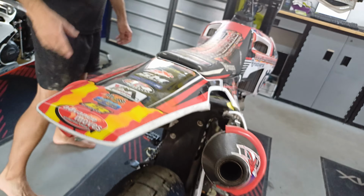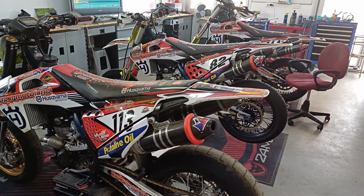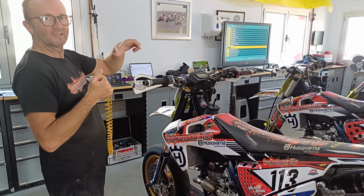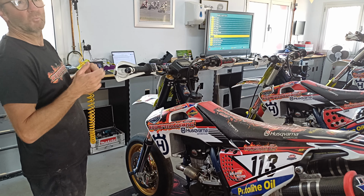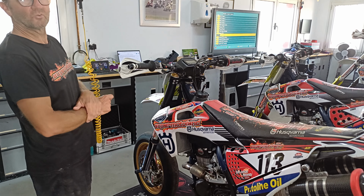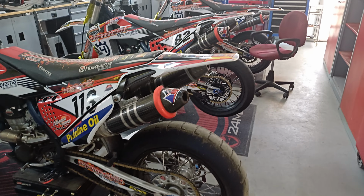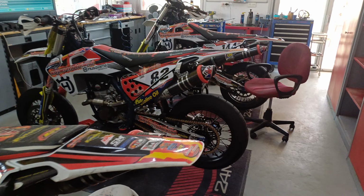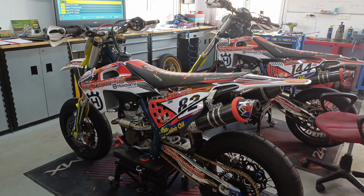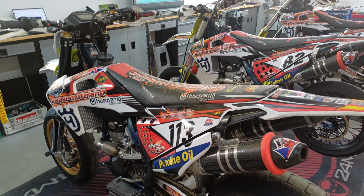What we find with the Supermoto is we're always trying to still be able to back a bike in with either the finger brake or the thumb brake. So you do need a lot of power there. It's not like in road racing where you're just tickling and controlling the bike, like wheelie control and stuff like that with the thumb brake. With our thumb brake Supermoto, we do want to be able to slide the bike into a corner still. So there's always a question mark of whether you can achieve that. But we've done that with the finger brake system, which Loris and Nick both run, and they're very happy with that. But Ryan wants to try it with a thumb brake because he fitted one to his mini bike and loved it. So now he wants to try it there.